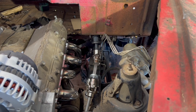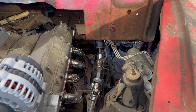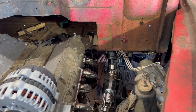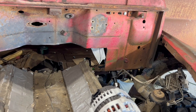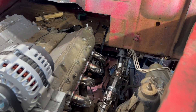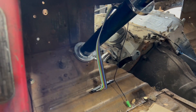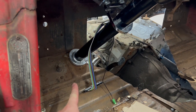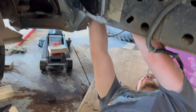Let's get this in here to test it out. This is where I'm thinking about putting it, but you can see that's kind of close to the header, so I want to move the pedal closer to the chassis. If you go inside the cab there isn't much room to put a brake or accelerator pedal to the right of that. So I want to move this pedal three more inches to the left to make room for the accelerator pedal and give us more clearance from the exhaust.